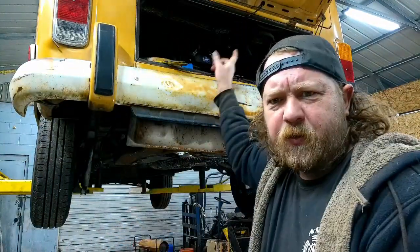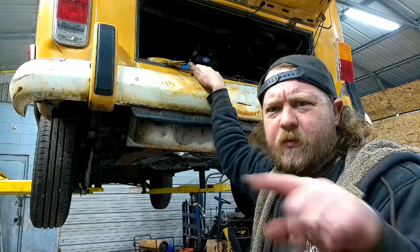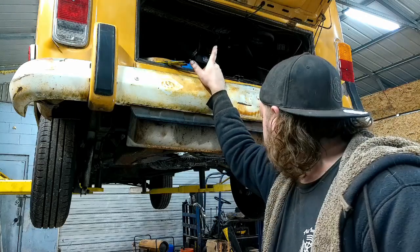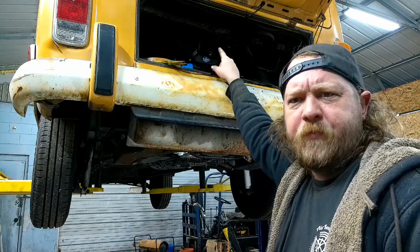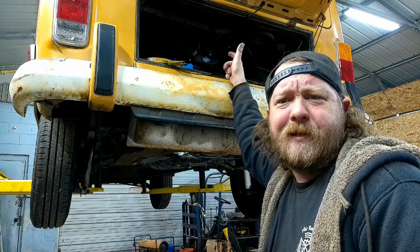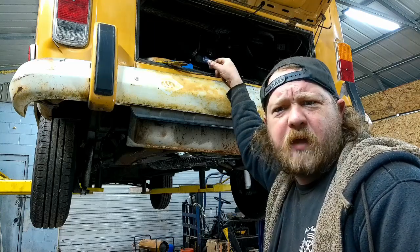We're going to eliminate the filter under there because it's a redundant, redundant system, I guess. There are way too many of them. It has really filtered fuel, but I'm going to get rid of that filter and run a new line all the way from the carb down to the fuel filter that's in there, because it looks clean. So let me do that now.